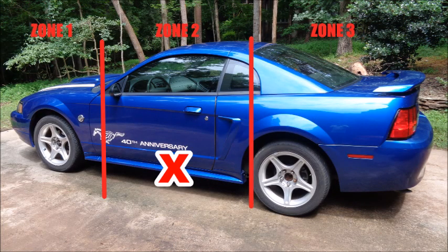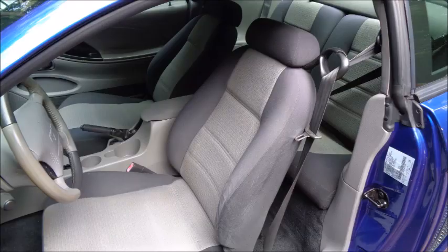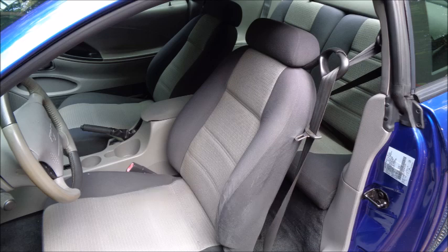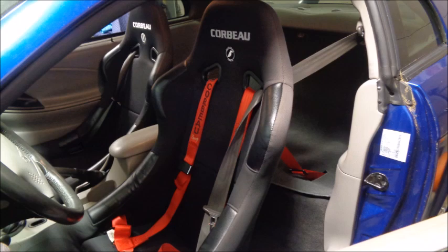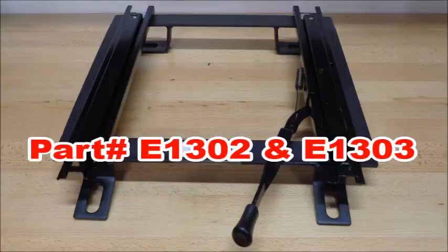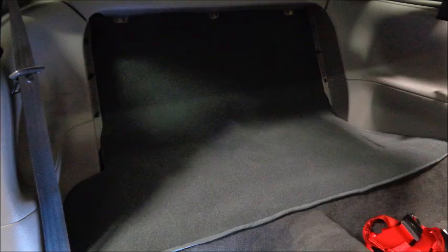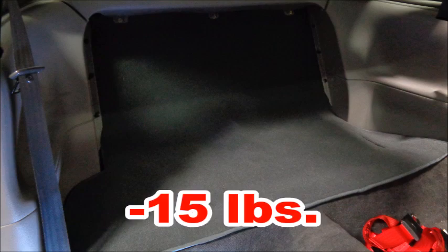The fit system and dual exhaust added 57 lbs to Zone 2, exactly where I want it, low on the chassis. But there's weight in the guts of this car that isn't helping — the seats. Combined, the factory front cloth seats weigh 104 lbs, and the factory rear seat weighs 20 lbs. A lot of that weight is at or above the waistline of the car. Losing mass high in the car means I can add it in low later if I need to make weight. I went with Corbeau's Forza fixed-back seats. They weigh 19 lbs each, and they require Corbeau seat brackets that weigh 7 lbs each. Combined, you're saving 52 lbs over the stock front seats. Cam rules allow for the rear seats to be removed, provided the lower seat area is covered. You could spend $150 on a rear seat delete, or just do what I did and spend $20 on carpet from a fabric store and cut it to fit the area. My 5 lb rear seat delete cuts another 15 lbs from Zone 2.